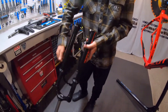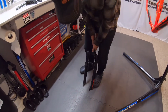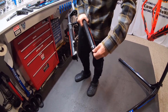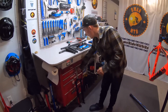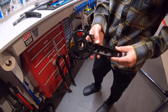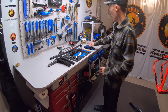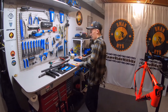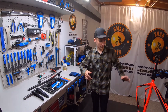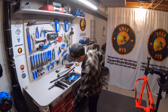The Recon has lockout, the air chamber is here, and to make the fork go up and down either slower or faster you just adjust this little knob at the bottom. The crankset we have is a Race Face one with a 28-tooth chainring and a 175mm crank. The bottom bracket is right here. The tools I'll be using are a 10mm, 8mm, 5mm, and 4mm, and obviously grease.